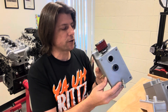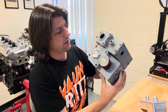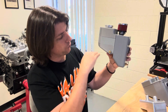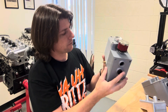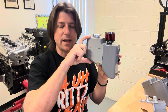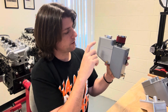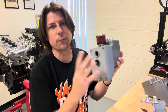Here's the revised version. First thing you'll notice — it's quite a bit bigger. I added an inch to the whole width of the catch can combo; you can see the original one is about an inch thinner. I also changed the bottom profile shape of the catch can to better fit into the wheel well of the AE86, which also gives a little bit of added capacity on the backside. Another thing I did to reduce cost and ease machining: since the tank is very tall and it's difficult to machine deep into a part, I split the can somewhat in the middle. This allows me to machine out the insides of both parts a lot quicker, reducing cycle time and reducing the cost.